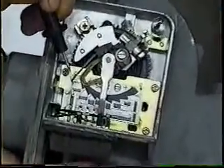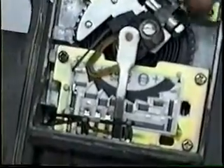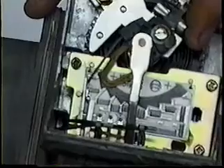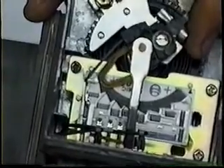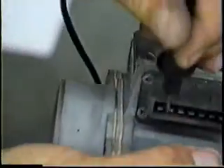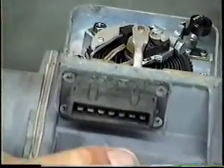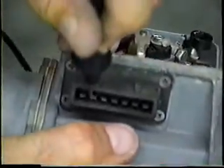Right here is the micro switch which shuts the fuel pump off. In the rest position this is open. As the flap moves approximately five degrees, that little spring-loaded tab makes contact. So these first two wires are the most critical for making sure the fuel pump will run. If you disconnect this wire and bridge these two, your fuel pump should run with the key in the on position — that's how you test a bad flow meter.